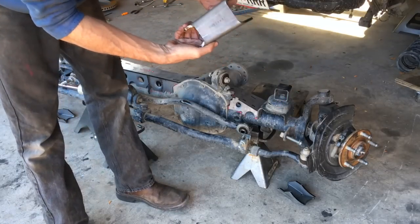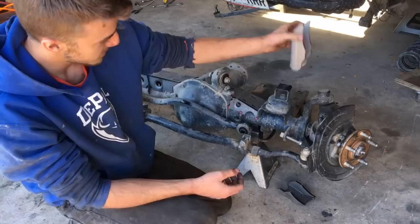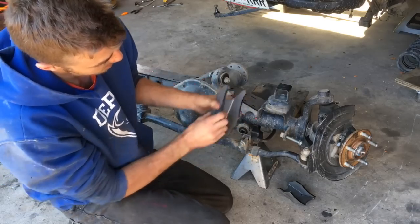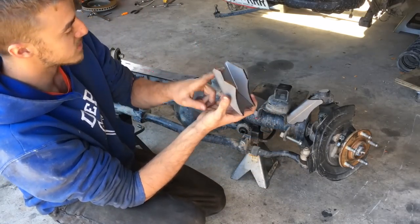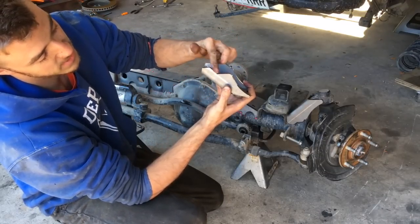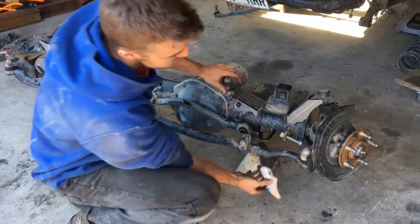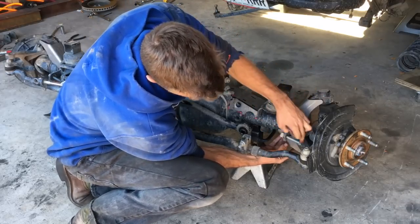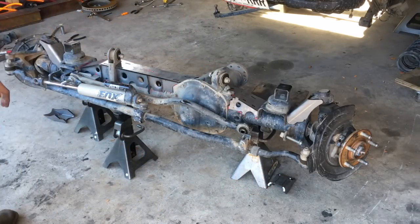I'm also doing gussets — there's an upper piece for your knuckle. JK knuckles bend really easily, so the top piece fits right in with bends designed to go with your outer axle. Then there's a lower piece. The uppers are the same but the lowers are different — one has an angle and one is smooth. That's because of your sway bar, so it fits around the sway bar link. Mark around there, figure out where to clean, then wire wheel or flat disc it nice and smooth.